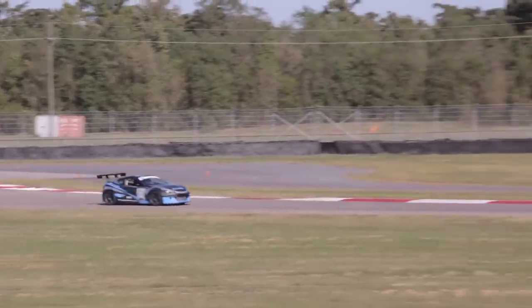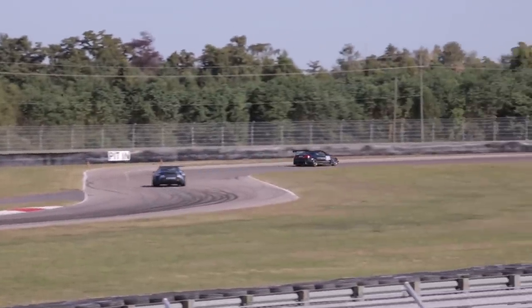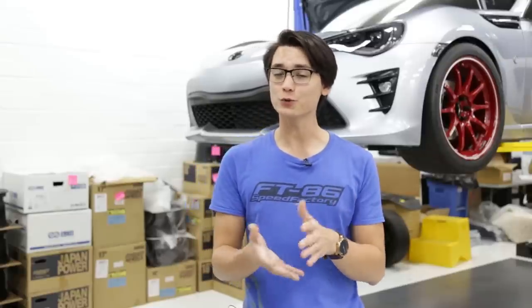To wrap things up, you don't need an aggressive six puck clutch just to hold the power of basic bolt-ons or even moderate boost. On our last time attack car — a turbocharged FRS — we were running about 390 wheel horsepower with 300 foot-pounds of torque and using ACT's XT street clutch, which is a full face organic material clutch, and we were holding down the power just fine. But if you want more aggressive clutch engagement — maybe you're building a drift car and want that aggressive clutch kick — then consider a six puck, or even a three or four puck, just be aware it's going to cause more wear on your transmission and the clutch itself will wear out faster.